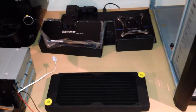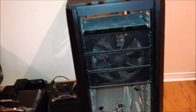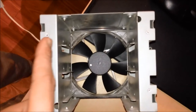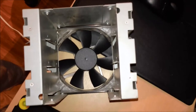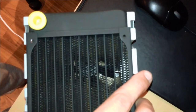What I'm going to do this weekend is retrofit into the Antec 900 in the front. I'm going to do a push-pull configuration mod with the radiator behind these two. The issue is going to be dealing with the thickness of the drive bays right here. What we're going to have to do is cut pretty much half of this off and cut all the way down because it's excess. It'll be held together by the sides and staple in as well.